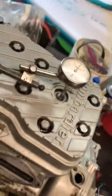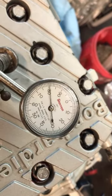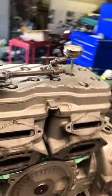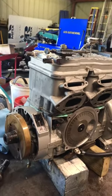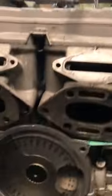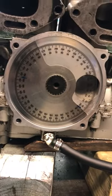We're making sure we're on top dead center, and we are. This is a GTX 787 RFI engine. We need to make sure that the magneto-side piston is at top dead center, and then we're going to set the rotary valve timing as it's supposed to be.